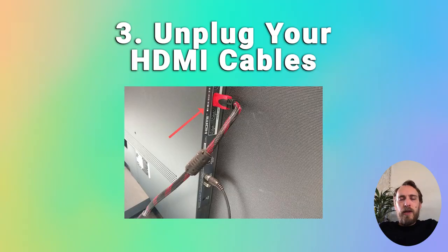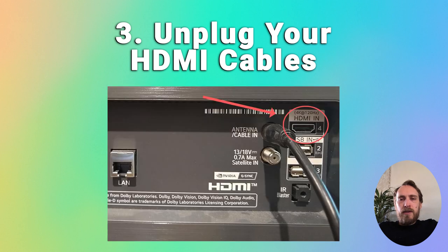You should also make sure there's no signal noise being created by an HDMI cable not being connected properly. Take out any HDMI cables and other physical cables other than your power cable. Pull up your on-screen menu and see if the screen has gone back to normal. If it has, try cleaning your cables and connectors and replacing them one by one until you find the failed cable.